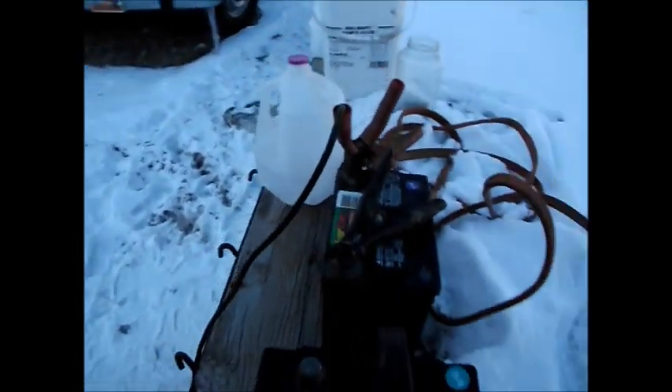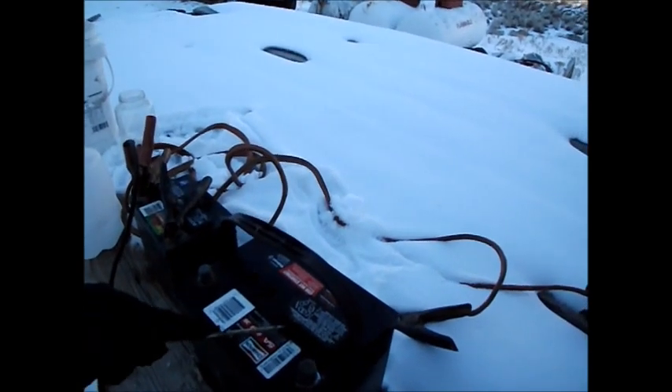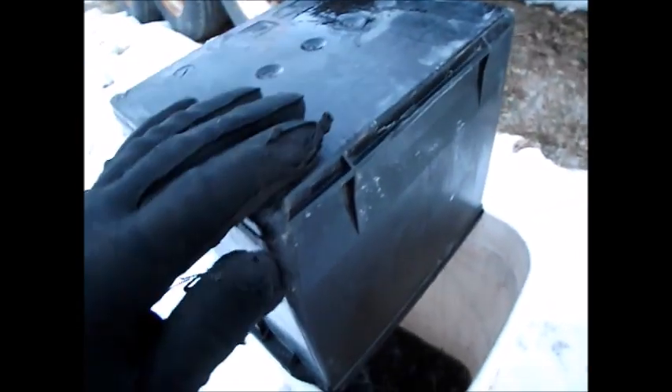So what you want to do is keep the battery in a charged state — maybe put a trickle charger on it. But the easiest way for me to store the batteries is to actually eliminate the possibility of a chemical reaction happening by removing one of the reactants. Now I can't remove the lead, but I can remove the acid. Dumping the acid out of the battery — with no electrolyte, the chemical reactions cannot possibly take place.